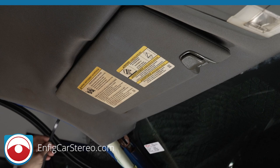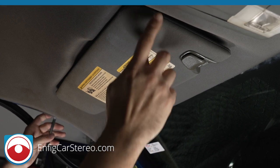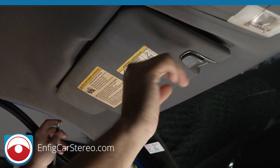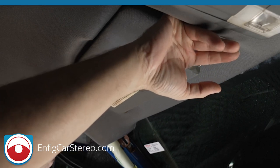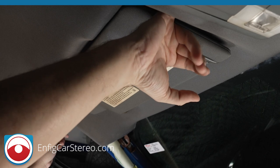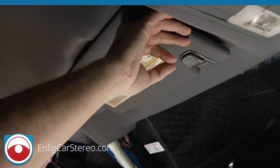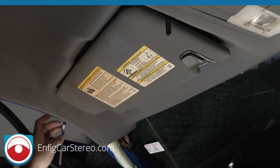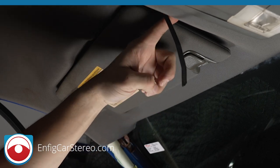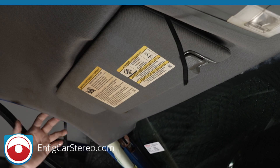Check your mark — it should be about where the hole is. When it goes past, you're going to stick your finger in here and feel for it. The best way to do this is to grab a hook tool — don't do what I do, especially if you've got fat knuckles. What you want to do honestly is grab a little hook tool, and maybe with a flashlight you can actually look in there and see the zip tie going through. Make sure it's above the airbag.